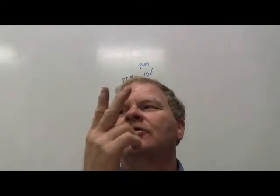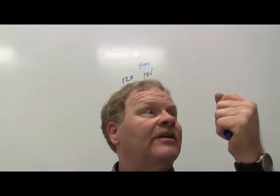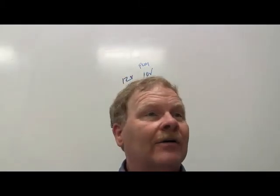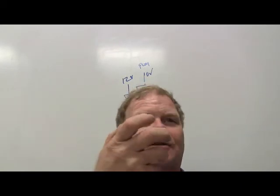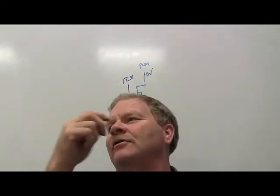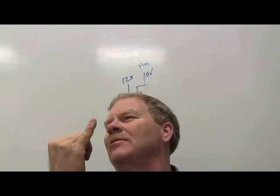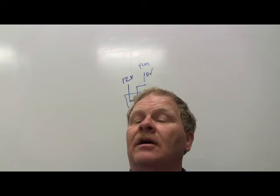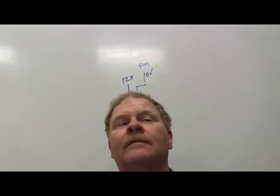So if I take this little tool I've made, and you can put a long lead on it if you want to, so you can pull it up here and hold it in your hand. It don't matter. Maybe you could put a little box that's got a light in it or something. But you just need a little light bulb, like a test light size bulb, and plug it into where the oxygen sensor goes, crank the car, that light should come on.